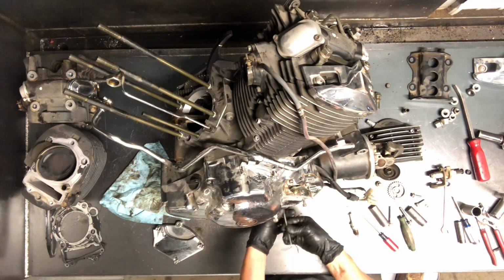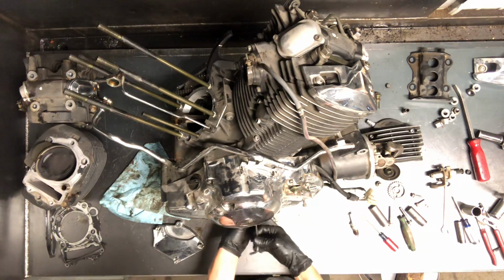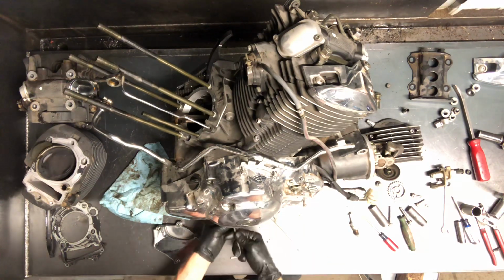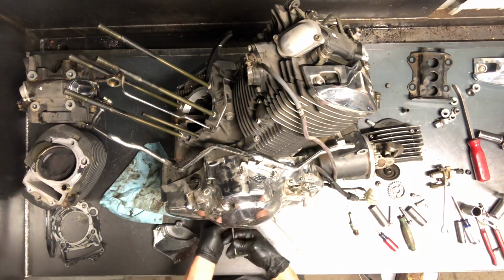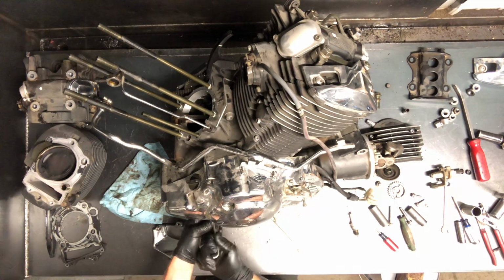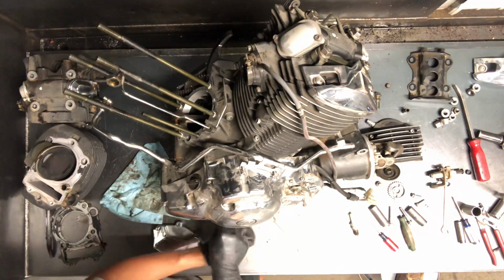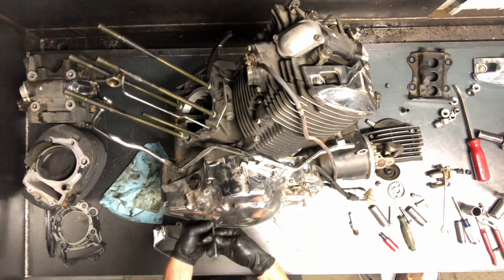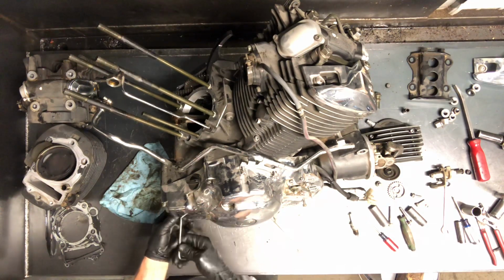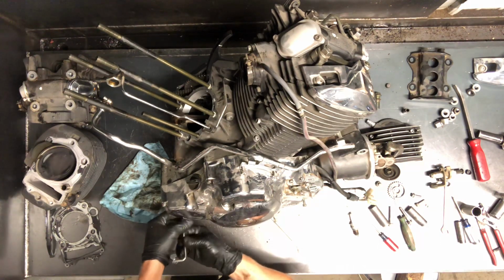A lot of Allens here. Your sight glass is underneath here, and again, check out my other video to see how you adjust valves. That requires pulling those two flat screwdriver caps there. You want to make sure you use a good size screwdriver, a very big screwdriver, to pull those caps. A lot of times if you use too small one, you'll end up scratching that cover up and rounding those off.